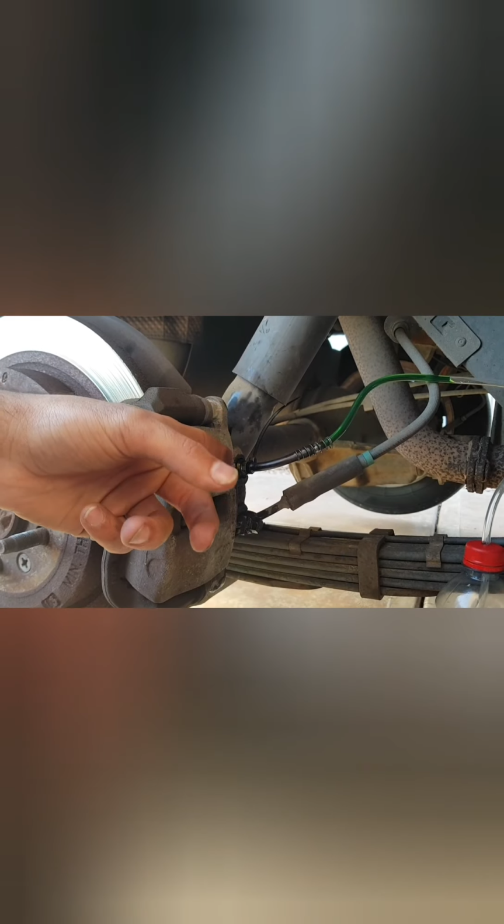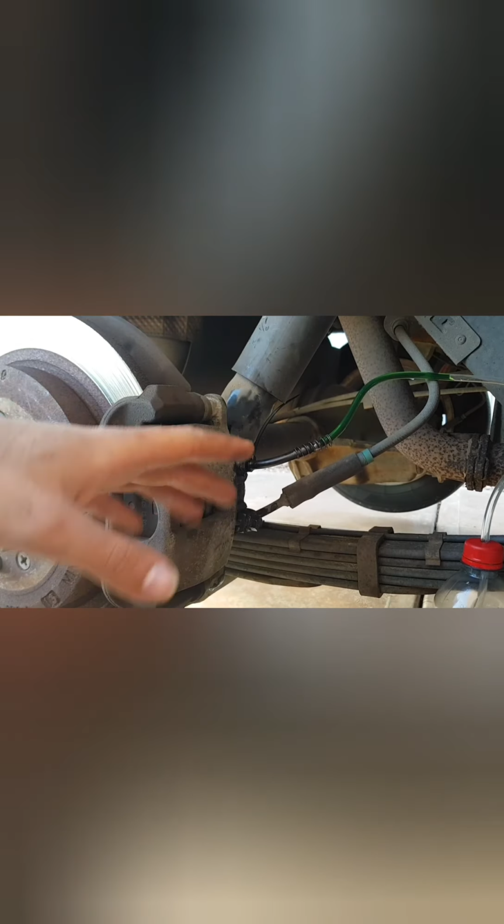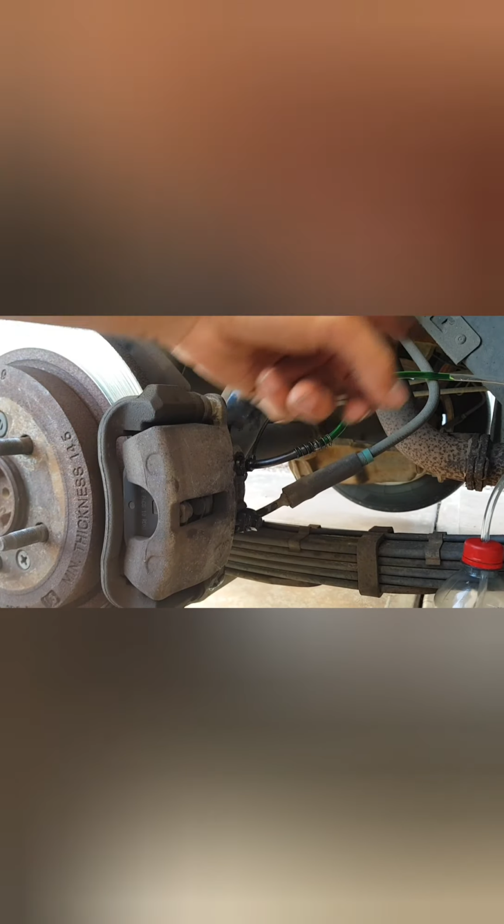Okay, so just press the button a couple times there. Okay, it's been good, guys, that I have run into some problems. That way you guys can learn from what's going on here. So what I found was, I just loosened it a little more, pumped the brake a couple times, even though it does feel a little bit harder and lower than usual. I pumped it maybe 5-6 times, and now we've started to get some fluid coming out.